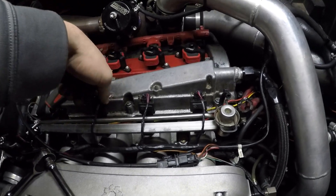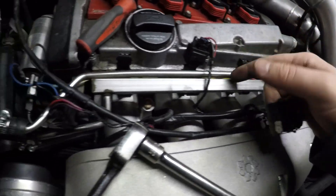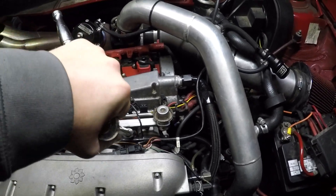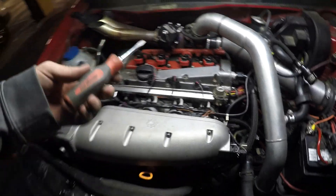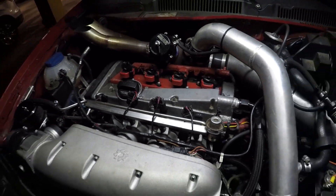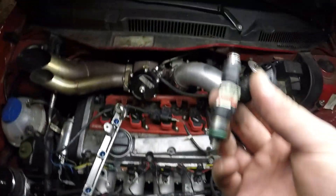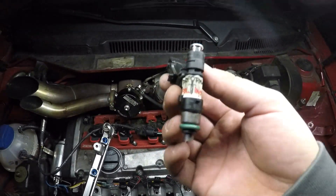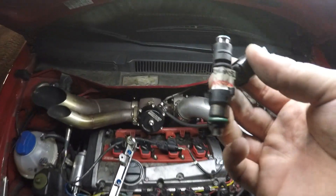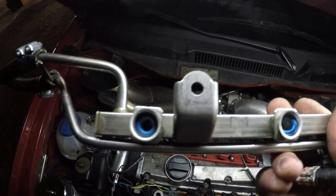Take off the injector clips — it's going to fight me. I'm going to get in here with my little flat head and take off these injector clips behind all four of these, and then I'll just be able to pop the fuel rail off. That's what the little injector clips look like, if anyone is wondering. So I got the fuel rail off, and these are the injectors I'm currently using — these are Bosch EV14 1000cc. I think I got them from Performance Fuel Injection on eBay; they were like $250. Great injectors, they've worked fantastic so far. When I pulled them out of the fuel rail, all the O-rings stayed in, so make sure to pick those off and put them back on all the injectors before putting the new rail on.